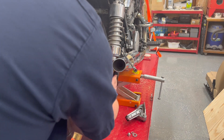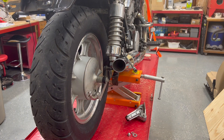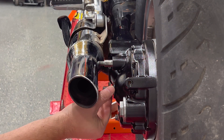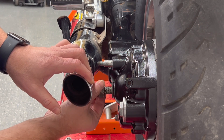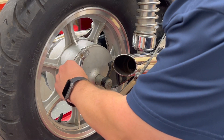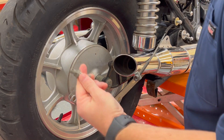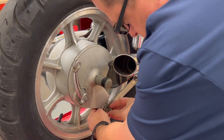You could also use a piece of wood between there — don't hit it with a regular hammer. I use a brass hammer. Our axle is all the way in. Got our axle nut and a cotter pin — we are going to trash that and put a new cotter pin in. The spacer goes on first, and then we've got some wiggle room on that muffler. We'll just thread the castle nut on. Now that we've got this on, next thing we're going to do is get our brake rod on there.